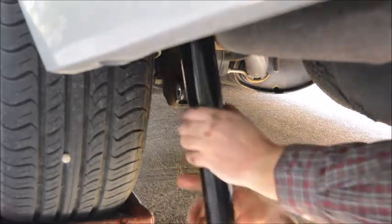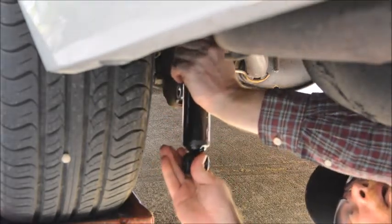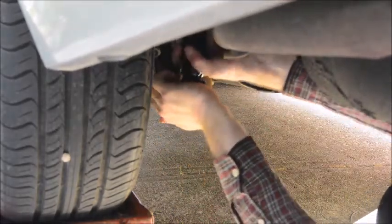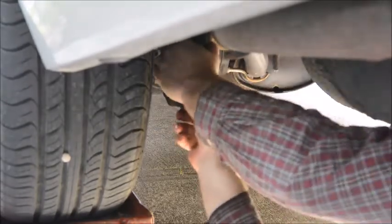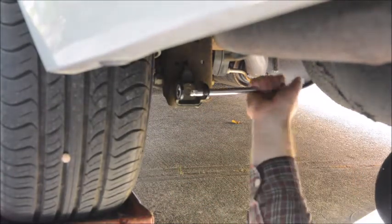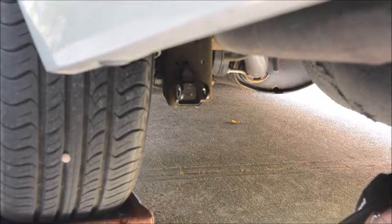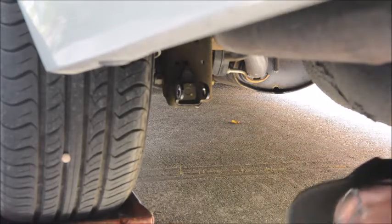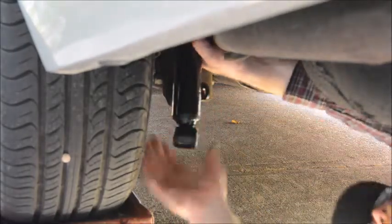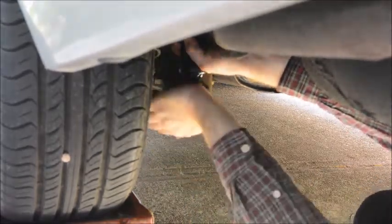We're going to compress the shock and seat it into the clevis. This isn't going particularly well, so I've bent this ear out a little bit to try and get the new clevis in, because it's just way too tight. Let's try with the clevis bent out a little bit and see if we can get the shock to go in there. We'll put this up through the hole in the body and compress the shock — there we go, finally, it looks like it's in.